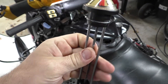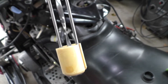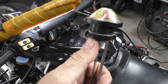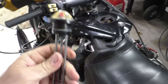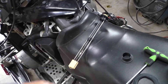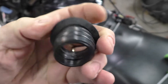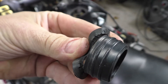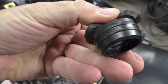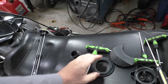In the case of this one, it just had a lot of junk in it. There's a fix for these where you take out the middle metal rod, take the float out, and then just file down a 32nd of an inch and round some shoulders on it. I actually tested this in a five-gallon tank of gas and it works. Based on the look of this, that's ethanol right there — that's the telltale sign. When you see those cracks and splits, that's ethanol. I've seen it too many times.